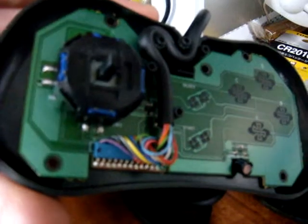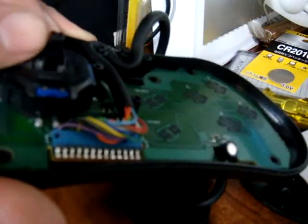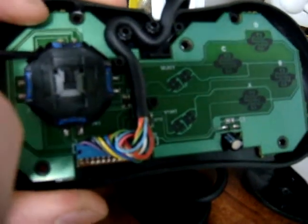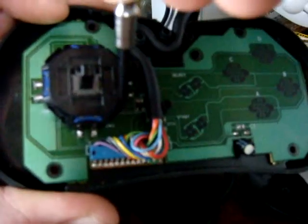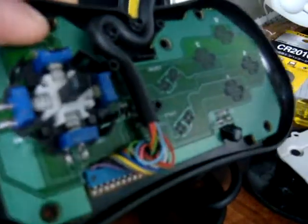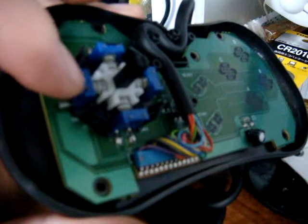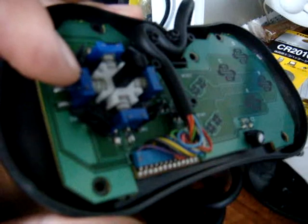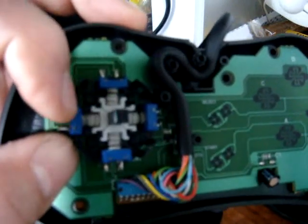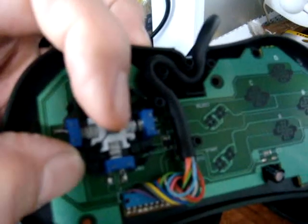You can take a look at your joystick here. Here are the switches — the blue ones — and they're all kind of concealed in this plastic case. The joystick pops out like this. If you have a flathead screwdriver, there are four tabs: one here, one here, one on this corner, and one down at the bottom. Normally when you get those tabs off, you should be able to pop this cover off. Here are the four switches — it's just a piece of metal and another piece of metal, like two metal tabs. The one tab just flexes on the inside, makes contact, goes back, makes contact, goes back due to these springs. There are these plastic little levers here, and when you push left or right, it goes in and then comes back out.